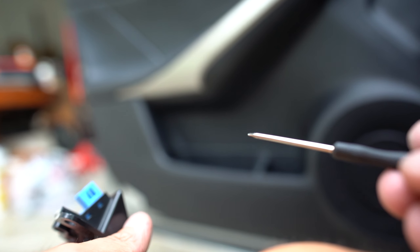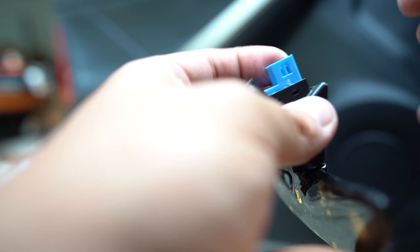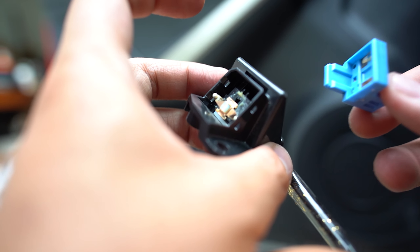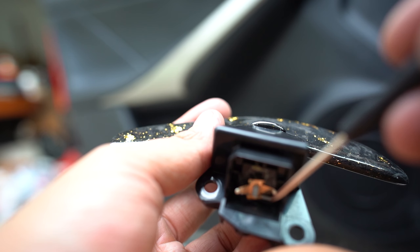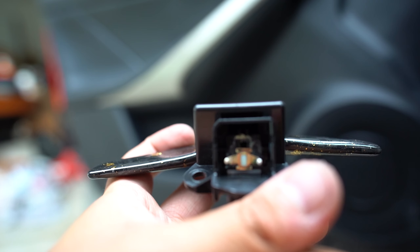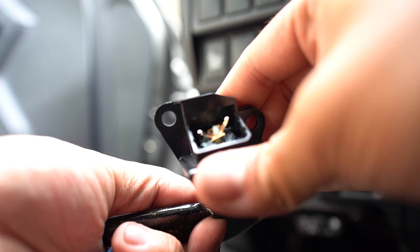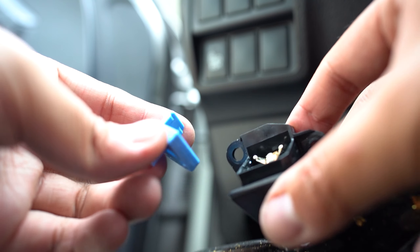Using a precision flathead, pry it up and pop it out — wedge it back and forth top and bottom. Once you get it popped out, this should come free. The problem is that there are metal contacts inside and metal contacts on the back side, and one of them isn't making connection because it's flat and not actually touching the other piece. So we just have to bend these up towards each other into a little V shape. The reason this happens is these metal contacts move and slide whenever you push the paddle, making contact with the copper inside to signal a downshift or upshift.